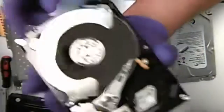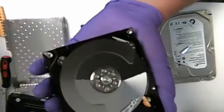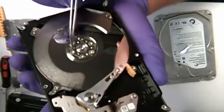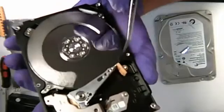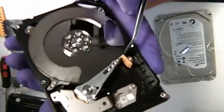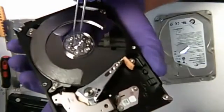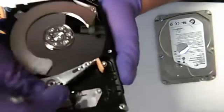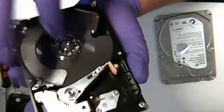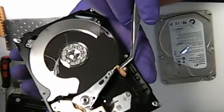Hello folks, I just solved the problem. This hard drive was unable to start for one simple reason: there is a head over here on this side, and this head over here was stuck behind this point about one-eighth. So basically that's where it has to be — that's where it stops — but it was almost a quarter inside, so what we're going to do is move them back a little bit.